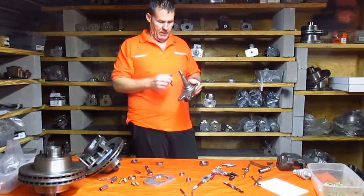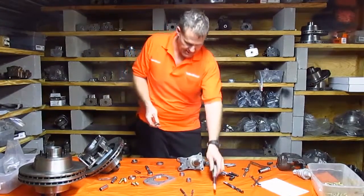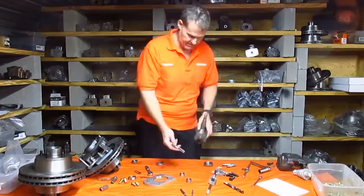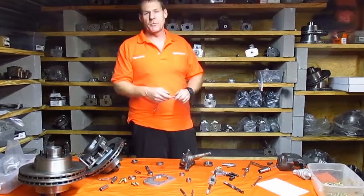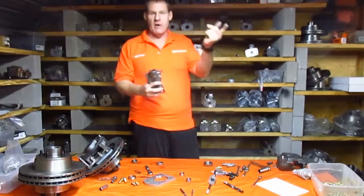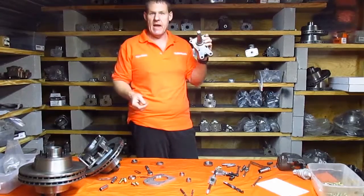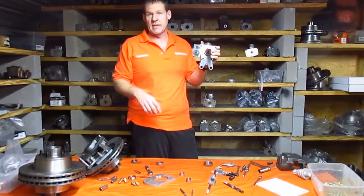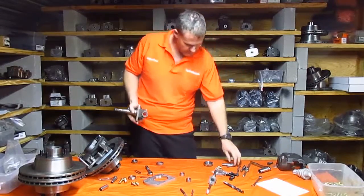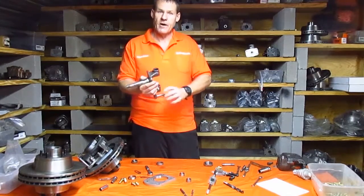A little tip we've learned: the spindle pin is kind of in the way, so start it with your T-handle device and get it going straight. Then you can come in with gear wrenches, which are real handy, and tap it on out real quick. It's actually one of those installations that's easy to do on the truck because you can leave the steering arm and steering linkage hooked up. While you're doing the drilling and tapping, it's not pivoting back and forth — it holds rigid, making it quite easy to do as a field install.